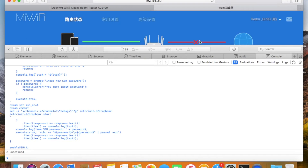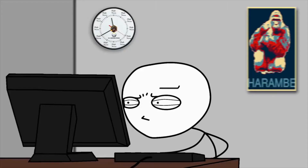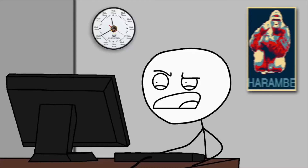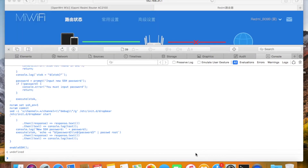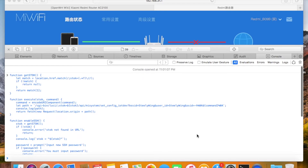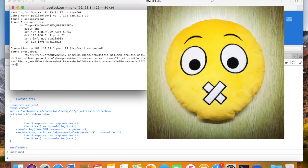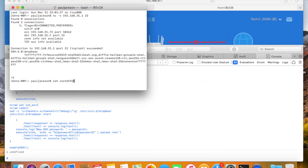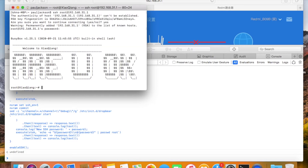After the JavaScript code is executed, we do a test again. The SSH port is... it's still refusing connection. Nothing seems to be wrong — I'm just following the instructions. It's unlocked! I just didn't know it takes a few seconds to open the port. Now let's continue — just log into the router, then copy the OpenWrt images into the TMP directory.